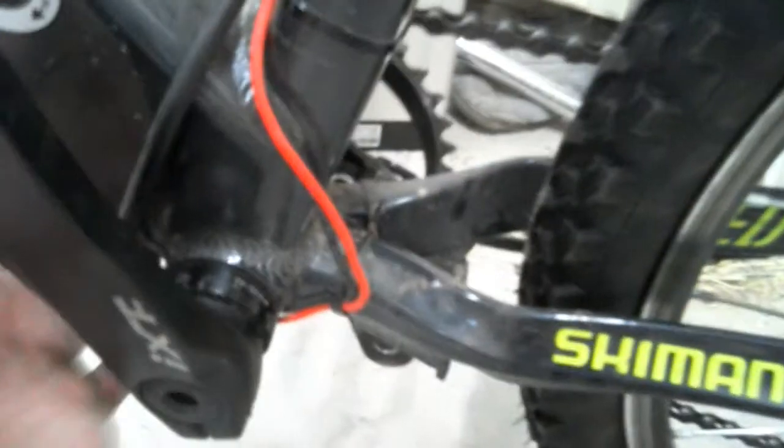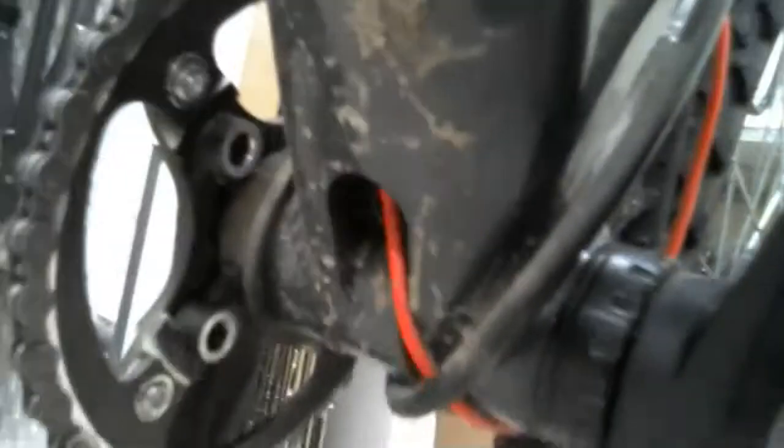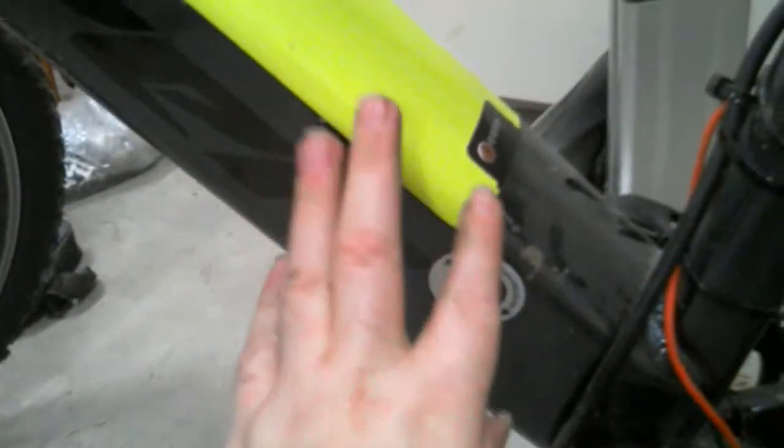And then I cut some wires. As you can see, I cut the bag up a bit. It's on the other side, but I basically cut the bag from down in the middle and then ran the wires down here through the middle of the frame area where this metal connector piece is, and in between my wheel lock, and then here's the battery cable. So it's a little bit finicky, but I currently have the battery pack coming out of the hole of the bottom crank. As you can see down here, because the battery is in here, and the battery cables are actually down bottom here.